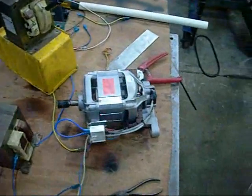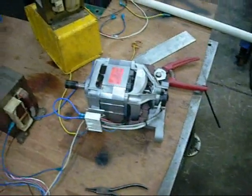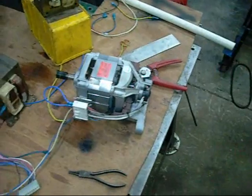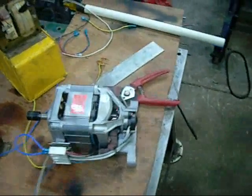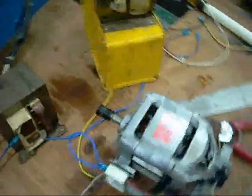G'day folks. This is one of the new videos I'm going to make — I'm going to play with this LG Intelli washer. It has an indirect variable speed AC motor. I should have realized these are AC motors, not DC. They don't have permanent magnets, they have field windings, so you have to link the brushes through the field windings to get your speed.